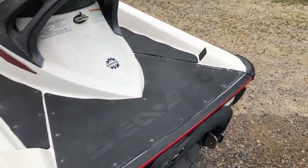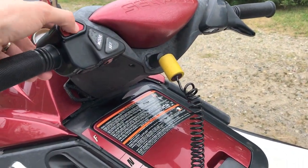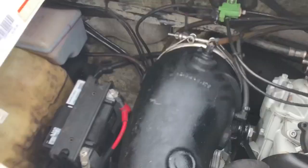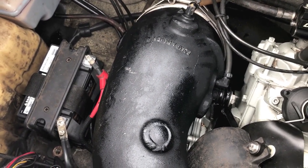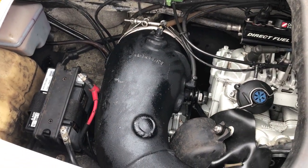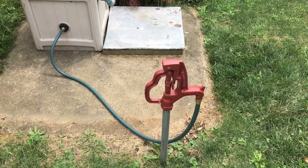It's been 10 minutes of running, and I'm just going to take the key out — and I've got great news: we have no leaks. Now we are going to take the jet ski to the launch at the lake, launch the jet ski, and get it up to full speed for a few minutes, and verify no leaks after that. Turn off the water and unhook the hose.